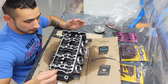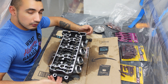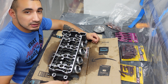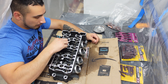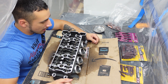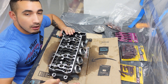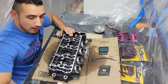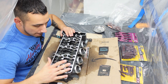What I did was put some Q-tips in each of the valve guides - I've got 20 Q-tips in here that cover the valve guides all the way to the bottom of the combustion chamber, so I'm going to try to keep all the debris on the other side where the ports are. I also blocked off where the exhaust comes through where you put your block-off plates, so I don't have any debris coming in. I'm going to use double-sided tape to mask off the whole surface and help keep a good seal - not only that, it will help prevent any dings or scratches. I'll also be putting the spark plugs back in because there's a hole that goes all the way through to the top of the head.